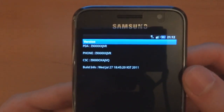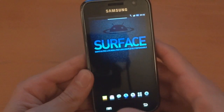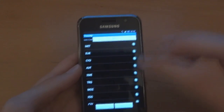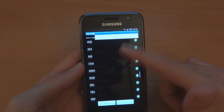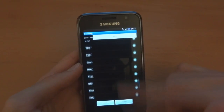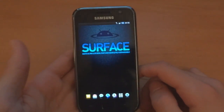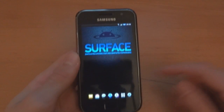There you go — JVR, JVR, and JVQ CSC, so it's kept the CSC from the JVQ installation. I'll go ahead and check the CSCs which come with the ROM. You'll need your IMEI number for this — dial star-hash-272-star then your IMEI number followed by hash. As you can see we've got a load of CSCs, which is absolutely excellent. I'm already on XEU so I don't have to change anything. A whole list of CSCs — I love it when ROMs have loads of CSCs because different people from different regions are going to flash the ROM. So there we go — excellent choice of CSCs and there's the finalized ROM. Hope you enjoyed this video guys — please rate, comment, and subscribe. TotallyDubbed out — bye bye!